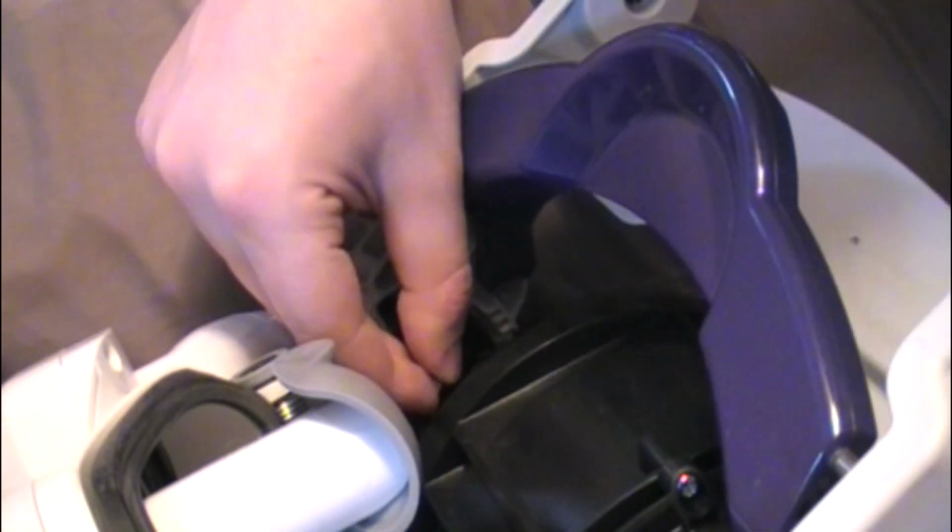So here I'm going to use my torx screwdriver, and I'm going to have to go in at an angle because it doesn't line up so well. I'll get a couple threads started and I'll finish it off with the pliers. One caveat with the pliers, I will speed up the plier tightening part. With the pliers, be careful that you don't strip the whole screw and the threads. It's a metal screw into plastic threads, so you could easily strip the whole joint, so just be careful.